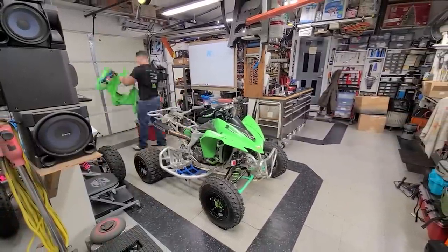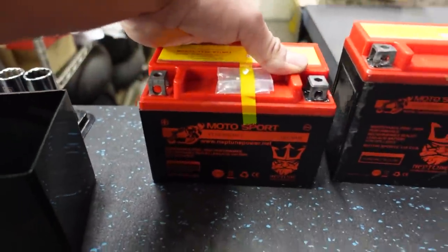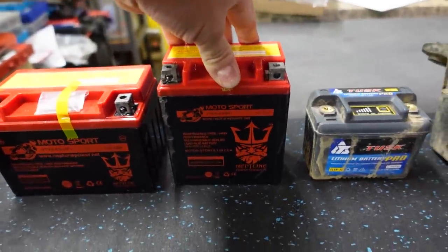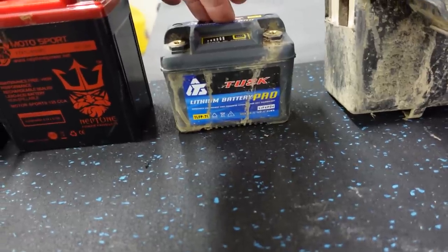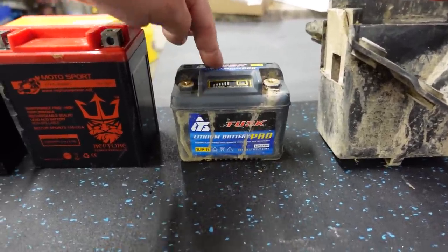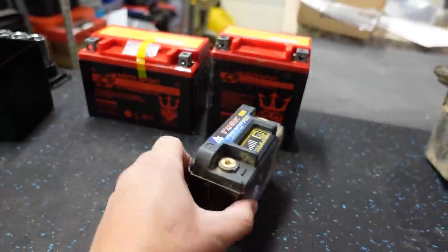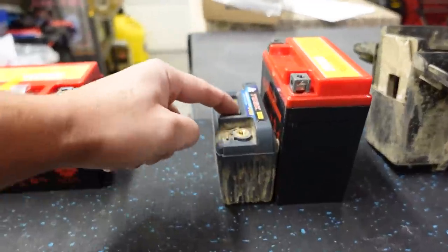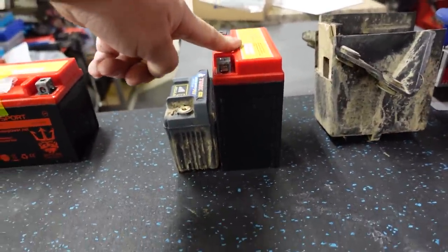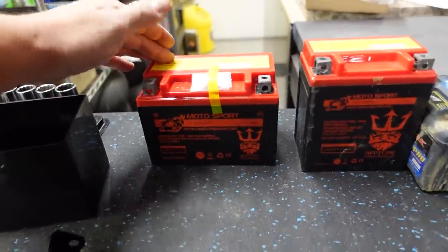I got the plastics and everything off. Tank is pulled back. Here are our batteries — wait till you see these things. So these three batteries: this is the 400EX battery, this is the traditional KFX battery — they're both the same brand but those are the OEM sizes — and then this is the lithium-ion battery from Tusk. I love Tusk, but this battery I do not recommend. I just didn't have good luck with it. It says it has a charge but I don't know how accurate that really was. You can see it's like microscopic even compared to the OEM battery. Supposedly this had 140 cold cranking amps, the OEM one has 135, and the 400EX battery has 180.